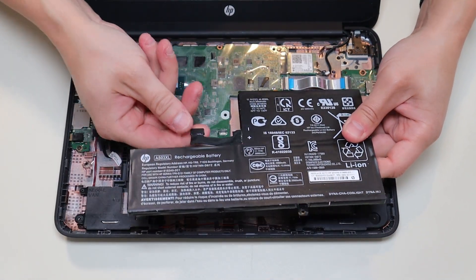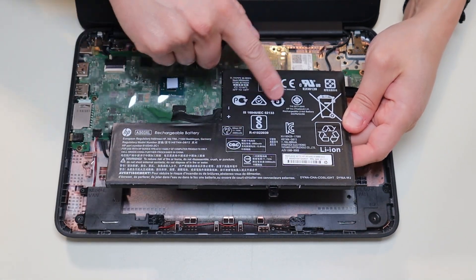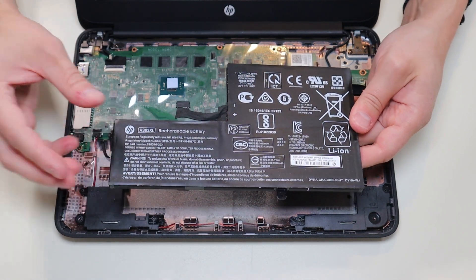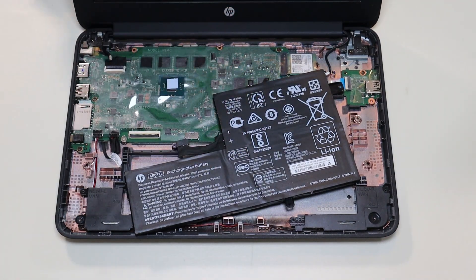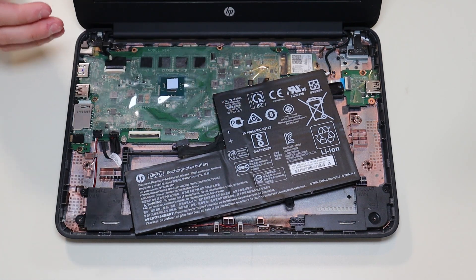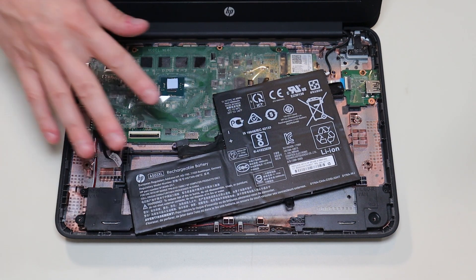It's not ideal — you want to avoid pulling on wires, but in this case I couldn't. I'll have the battery model number and all the specs listed below in the description, along with a battery replacement option in the tools and parts link. As a last note about your battery: if you're here because your computer's not turning on, it's possible your battery's bad, but a computer should still work with just a charger. There'll be a video link above and below in the description on how to troubleshoot a computer that's not turning on, because it may be something other than just a bad battery.